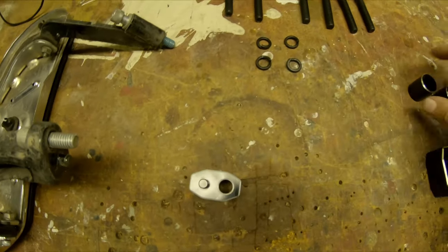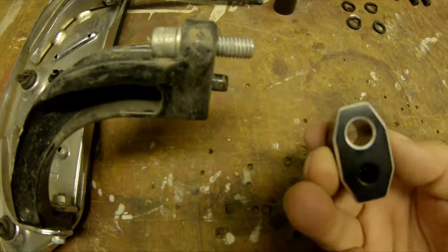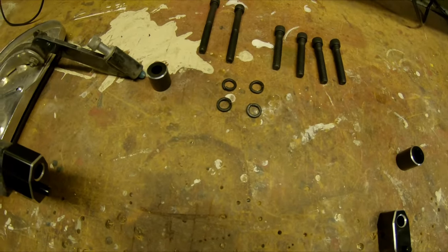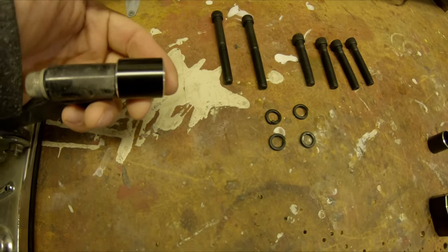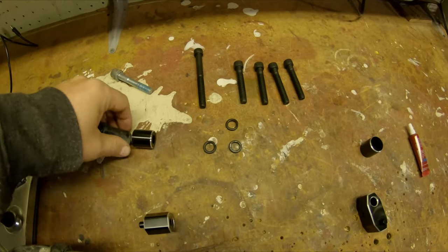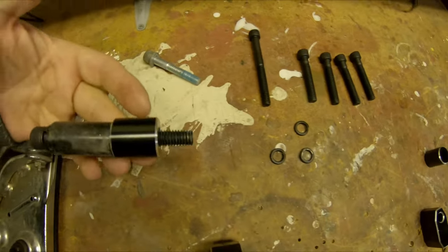The spacers go between the mount and the frame itself. Here's that little indexing pin — one side is down with a hole on the back so it just fits like that. I did bust out the old Loctite since you don't want your floorboards coming flying off. The rear spacer slides on the same way, with the longer bolts sticking through. You feed the long bolt through, add the lock washer, the round spacer, push it through, put the blue Loctite on, and spin it in.